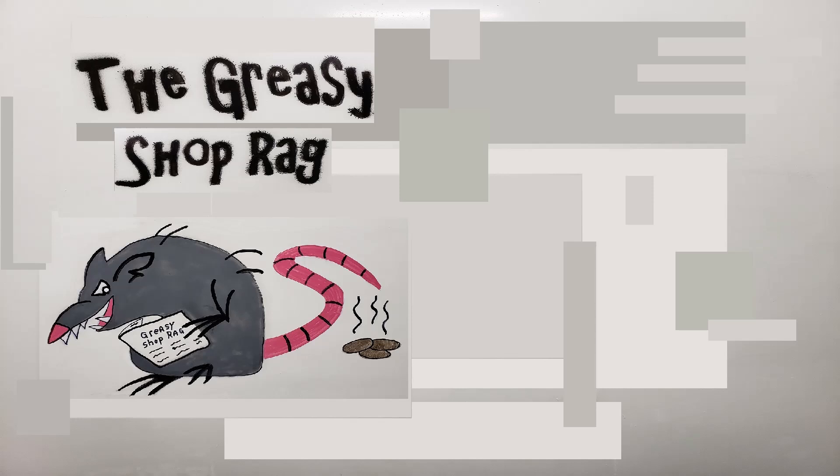We're going to look in the cylinder and make sure any further efforts are worthwhile. If this thing is scored I'm going to stop — but it looks good. It's clean and shiny, no scratches or scores. We're going to put a new spark plug in because I feel confident that we're going to get this running and back into the hands of the customer.